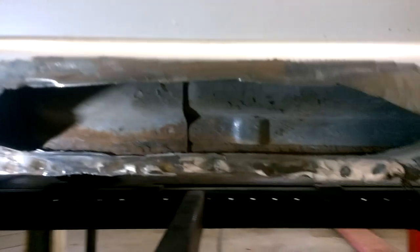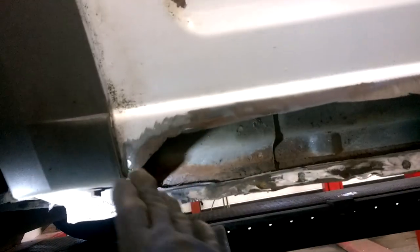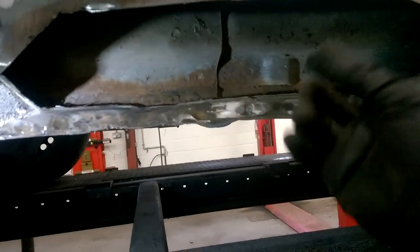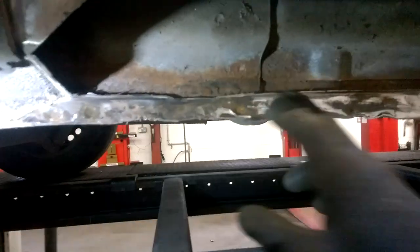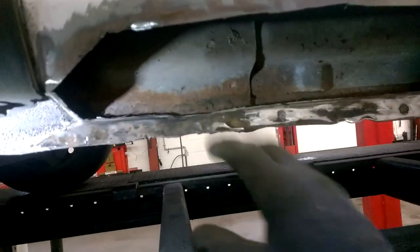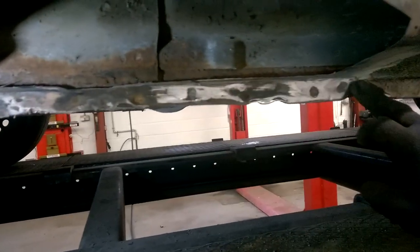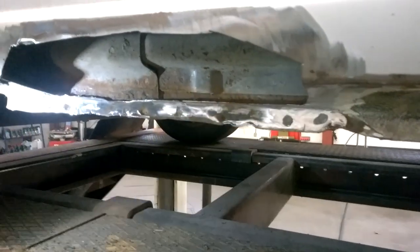The piece is now cut out in that section and as you can see the inside is solid, so the only issue was with this section here. Make sure that you cut out enough so that there is no corrosion within the steel. I'm going to prime all the inside for extra security — tape this off, prime all in there — just to give it that extra bit of safety so we don't have any issues like this years down the line. Next stage is to get pieces that fit this and prime on the inside.